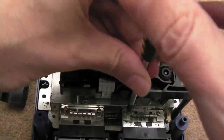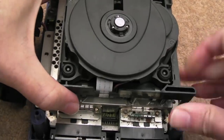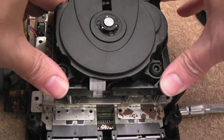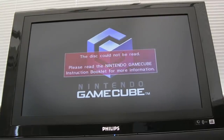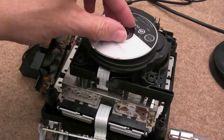So I'll strip the other one down and try the drive on this one. Remember, this one had a good drive because we tested it on my working GameCube, but obviously a dead motherboard — and the power supply was okay on that one as well. So let's clip the drive off. Now that's interesting because I'm sure this drive worked fine on the other GameCube. So it could suggest the power supply is an issue on this one as well, unless there's some motherboard damage. Maybe a bad connection on the drive connector. What I did was clean the laser lens — it looked cloudy because it's cold in this room, it got moisture on it. I cleaned it and then it booted okay.